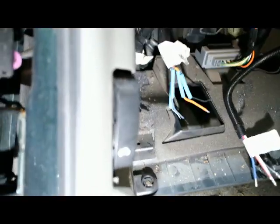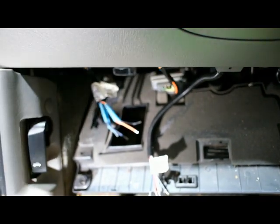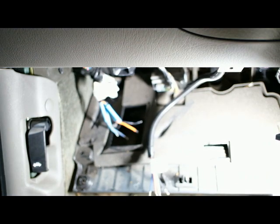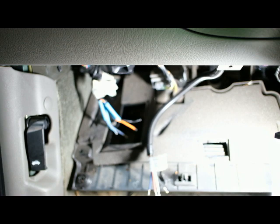Okay, so the reason that we need the center mounted stoplight wire is, by law, when you hit the manual brake button on your controller, button, slider, whatever it is, the trailer brake lights have to come on. Now, vehicles haven't been wired that way in the past, and I have no idea when that came to be a law, but I've been told you can actually be cited if they stop you and activate your manual trailer brake control and the lights don't come on. So either way,